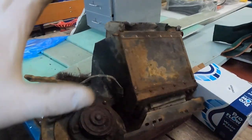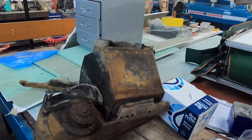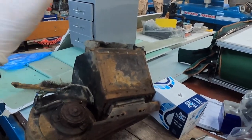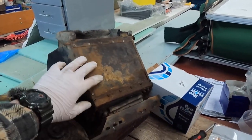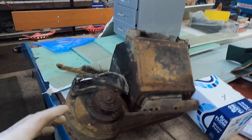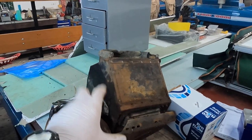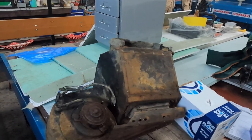What I'm doing now with the old heater boxes — I couldn't find a brand new one. Found a second-hand one where the motor's in good order, the matrix is in good order, and all the little switches work. Downside is the paint has started to come off — it's not rusted yet, but you know when the paint comes off and it stains, because in your engine bay where damp can get in and sit there it looks bad real quick. So it's worth brushing it down, getting it dried, getting some primer on there, and just resealing it before we put it back on.